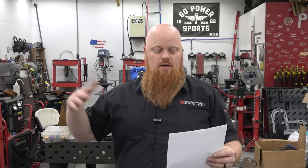This build wasn't specifically for horsepower or torque — this was just an all-around awesome build for a mini bike or yard cart. Now if we were trying to make a drag bike where horsepower numbers are the most important, we'd want more lift out of our cam, a bigger carb, bigger valves — make the engine perform better in the higher RPMs. Even though we were stretching it to nine grand, it really wouldn't make a ton of power — there's no real reason to push this engine that far.